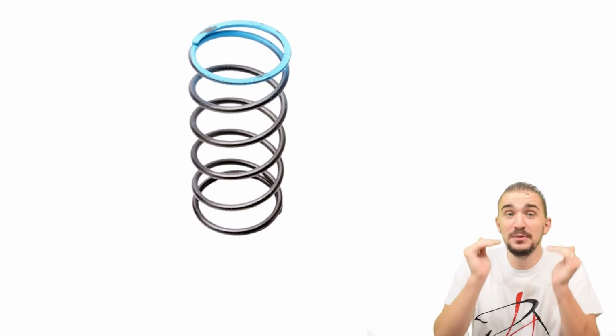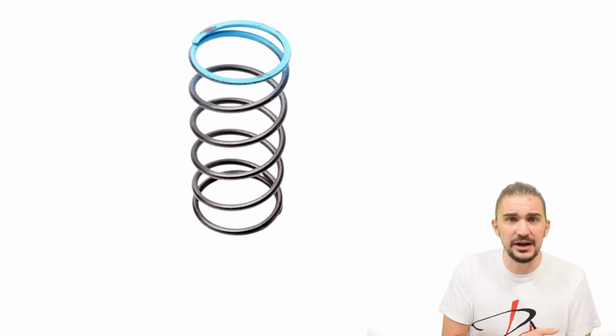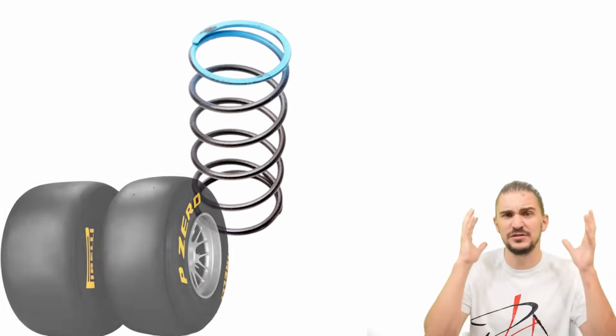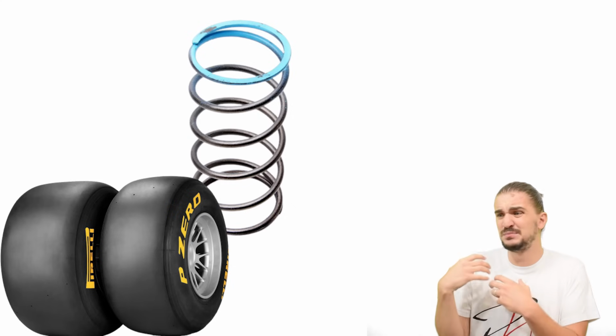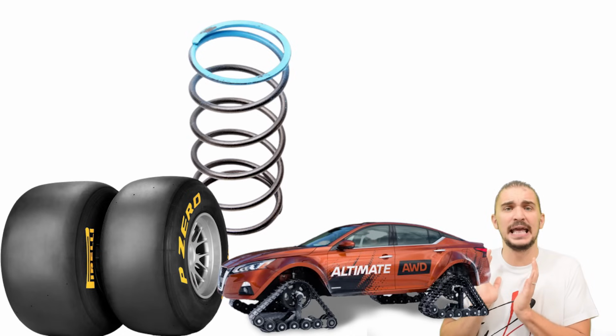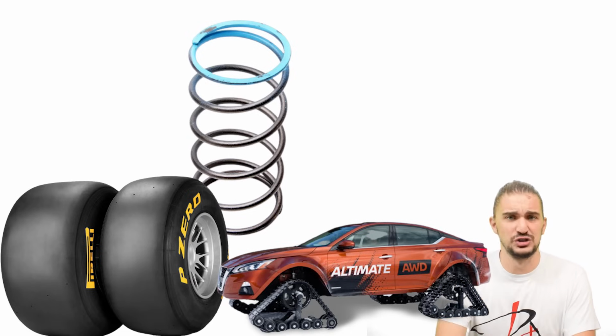So why is this happening? It's happening because 30 psi is the minimum boost you can make, and your setup is making it in first gear, second gear too. So unless you have some giant ultra fat tires or a stupidly advanced all-wheel drive system, you just created a burnout monster that has a stupid looking boost curve.